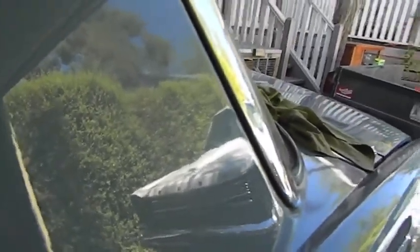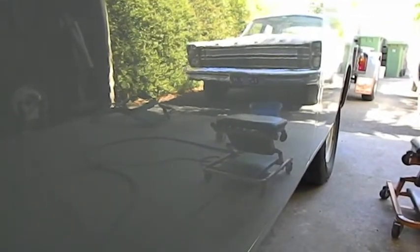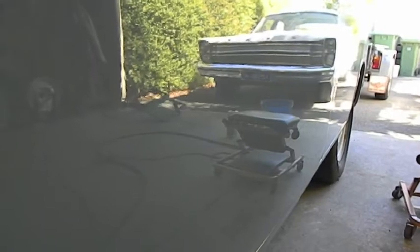Up on the roof, it's the same story. That's original, and that's what I've done. And mine's a little bit smoother, but it's still by no means as flat as I like it. But I just risk damaging the paint too much that I'd have to repaint the whole thing, and it does look reasonably presentable. It's a little bit ironic because although I did the side dead flat, the top's going to have orange peel, which is sort of the about face way of having it. Normally you'd have the top perfect and the sides might be a little bit peely, but this is going to have to be the other way because at the time I didn't know the paint was so thin.